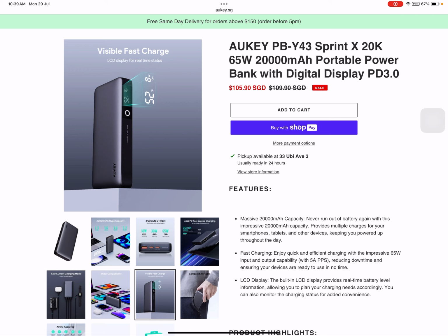When you are charging this power bank at home, I'm using a 100 watts adapter from Ugreen to charge this, and I do not leave it overnight, because the best is not to charge any power bank overnight when you go to sleep, because if there's a thermal runaway, your whole house will be burnt down. So with the indicator, it's good that when you are awake and at home, you charge it, and after half an hour, you can check whether it is full. If it's full at 100%, then you can unplug it and turn off the power, so you do not end up overcharging the power bank or causing any fire hazard.